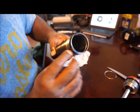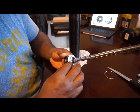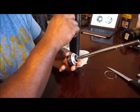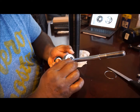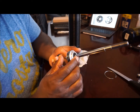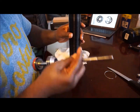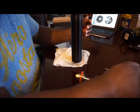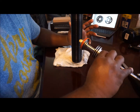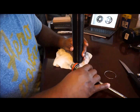I want to keep a void for this region here, otherwise it's going to be a pain in the butt if you fill it to the top — it can be difficult trying to squeeze the wiper seal portion into the shock body. So I keep a little void for it; once it's pressurized, that small void is not really an issue. I'm going to fill it up and then show you guys what's next.